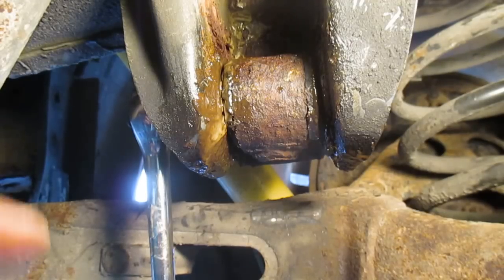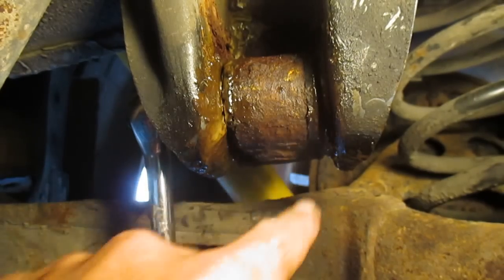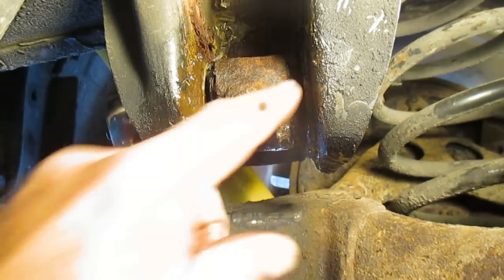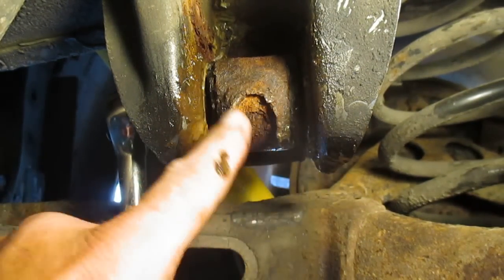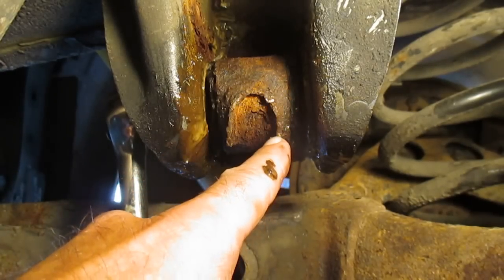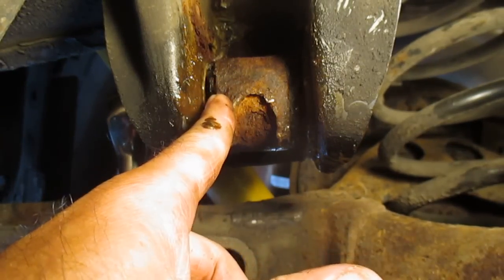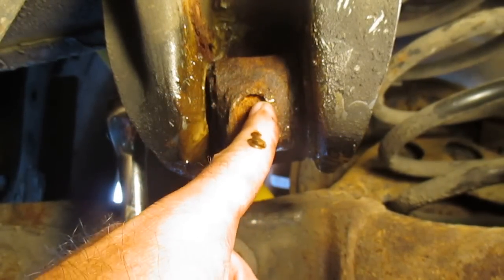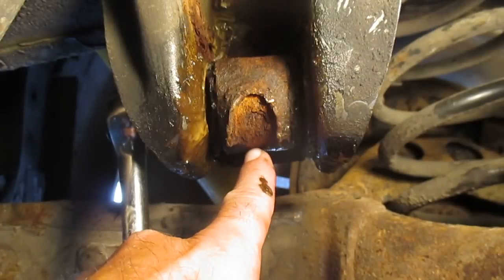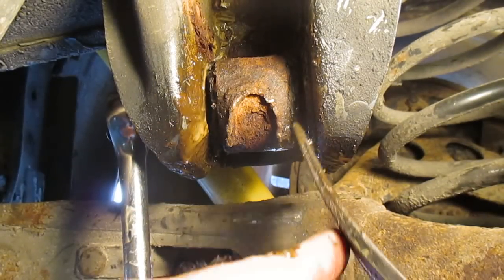Here are the remnants of a track bar on the rear of this vehicle — it is broken off. You'll see where it broke right there. This was going across the underside of the vehicle and this section broke. If the track bar hadn't broken off, I would normally release the other end and push up and down on it to break the seal within the bushing. Unfortunately it broke right off, so now I'm stuck with the end of the track bar stuck in place and the bushing within is very tight.